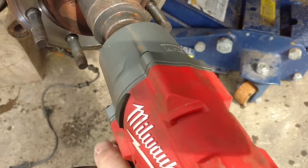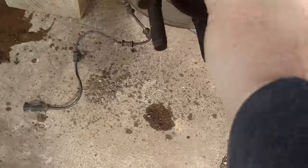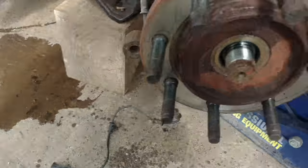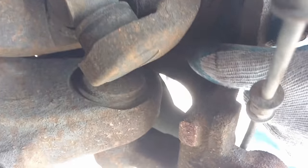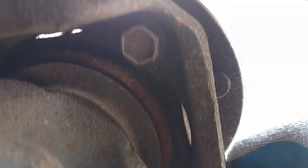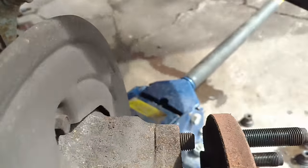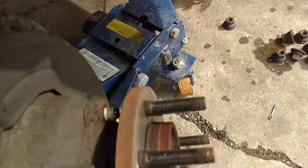Cover your ears. I take my washer off and now I'm ready to take the hub off — the wheel bearing hub assembly. There are two more bolts in the front, I believe they're 18mm. I'll spray them a little bit with blaster so they don't come out dry, so when I go to reuse them hopefully the threads will be okay. I go through a lot of blaster, as you can imagine, in our rusty part of the world. I got all the bolts out and the wire completely disconnected.